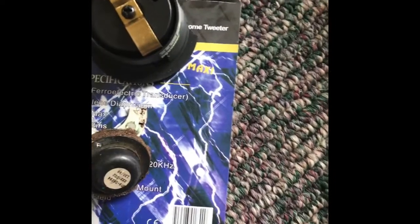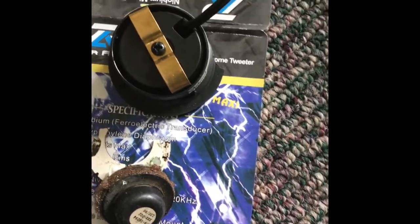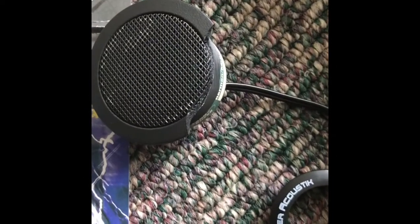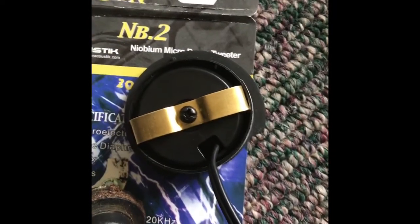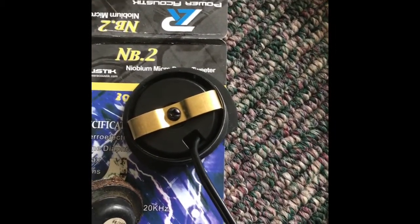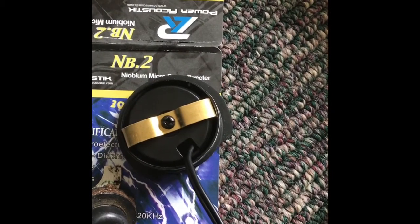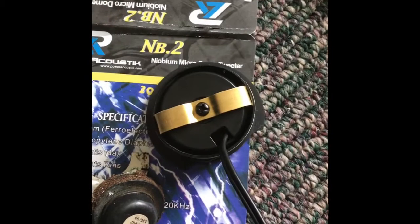The gold wire is positive and the silver wire is negative. In the truck, the green wire is positive and the blue and black wire is negative — I don't know what color it might be in another truck, but that's mine. I'm going to hook this system back up and do the other side. I think the other tweeter is no good either so I'm going to change that out too. As you can see I reused the casing for the Land Rover and built my own tweeter — it's not impossible. It sounds real nice in the truck.